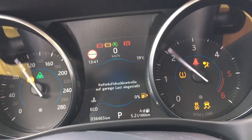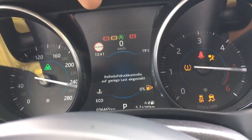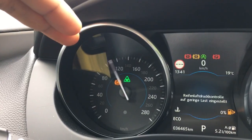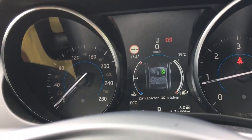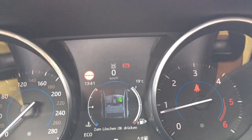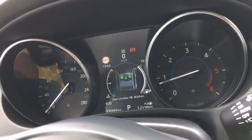There will also be special lights for tire pressure and ESP. The basic rule is all the warning lights should go off after a couple of seconds when we start the car. Now we can see that one of the warning lights is still on, which is the seat belt warning — one of the occupants has not worn the seat belt. Once I wear the seat belt, the warning light goes off.